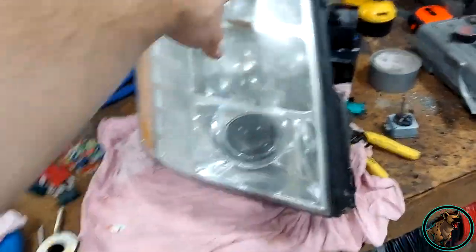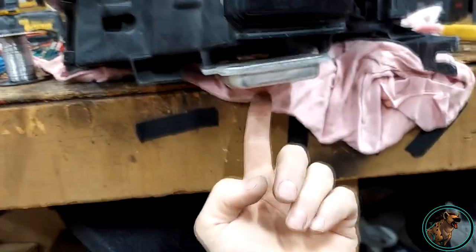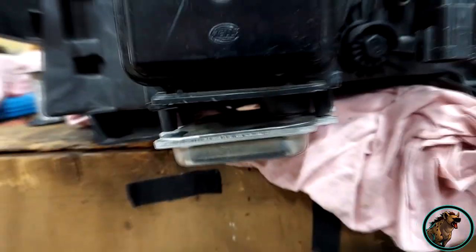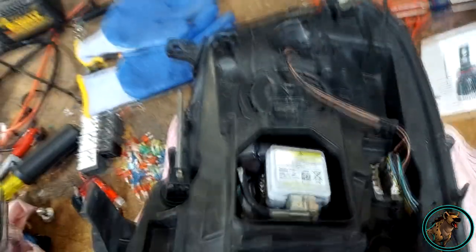Here we have the headlight removed. If your headlight's not working and you're trying to figure out why, this is the ballast I was telling you about. As you can see, it's on the very bottom, so when all that water settles down it comes right here. There's an electrical connection on the bottom of the ballast that gets full of water and shorts out. I've replaced this lens a couple times trying to keep everything factory and even tried to seal it with RTV, but you can still see the moisture — these things are terrible.